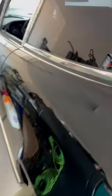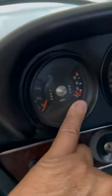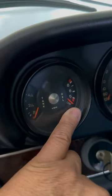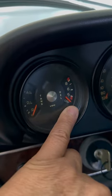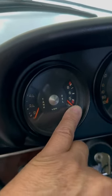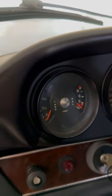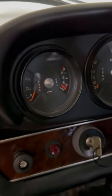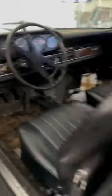The gauge in the car works only at idle. Right now the car's off so it's obviously off, but when you start the car it'll come up — I like to see it stay about at six. That's at idle. When you're driving the car, it's not going to read correctly at all because the oil is in circulation.